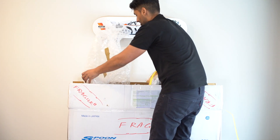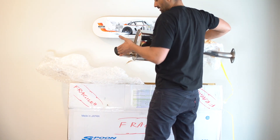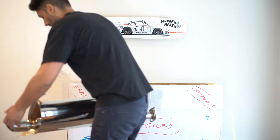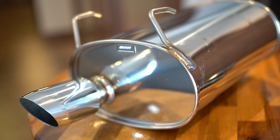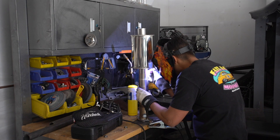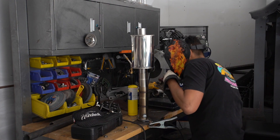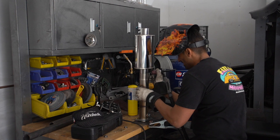To keep the look right, I went with the Spoon Street Type muffler — it's only an axle-back. The B-pipe wasn't available at the time, so I used a used Apex B-pipe and made my own resonated test pipe. The center resonator is a muffler from Vibrant Performance called the Ultra Quiet.